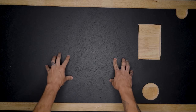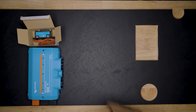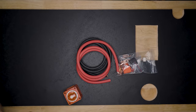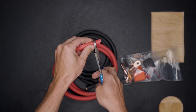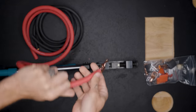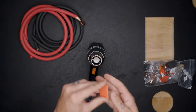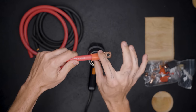We made our backer board with three-quarter inch plywood with a rubber coating on top that we will mount all of our components to, then move it into the camper. We're going to start with our Lynx distributor, the smart shunt, and our Lynx distributor wiring kit and start making our first wires. We're using the full length of wire for both of these, so we strip off a bit of insulation, put our lug onto our wire, put the lug into our crimper and crimp the lug onto the wire, then use our heat gun to put some adhesive-lined heat shrink onto the lug for a bit of extra protection and strain relief.